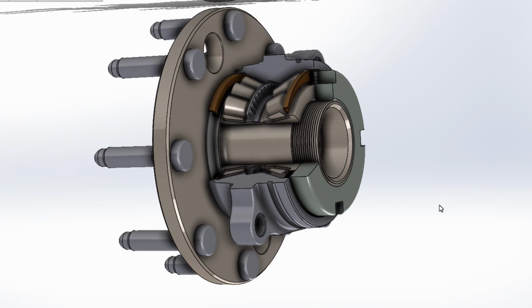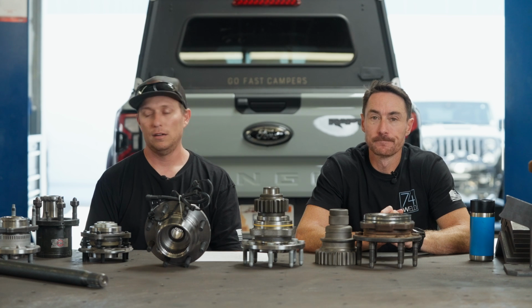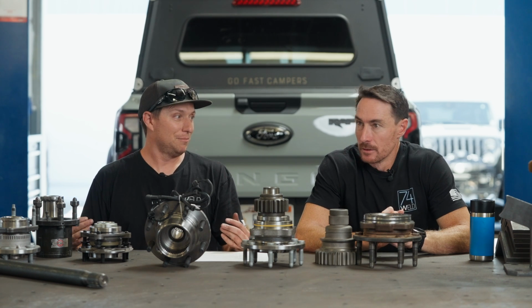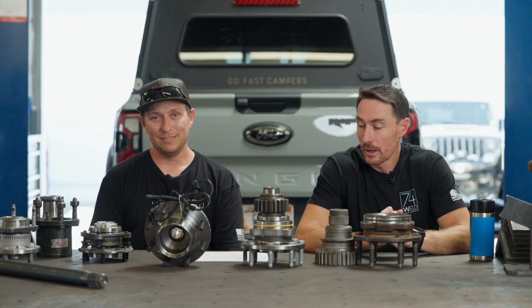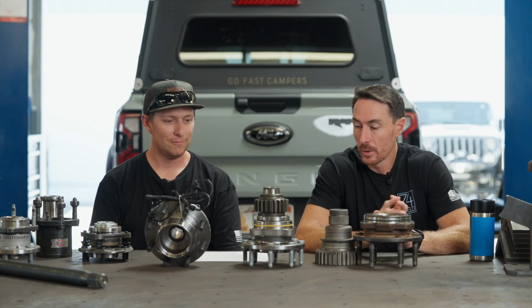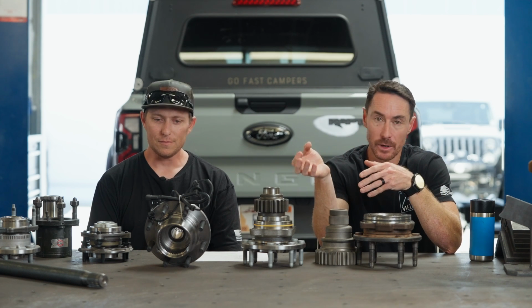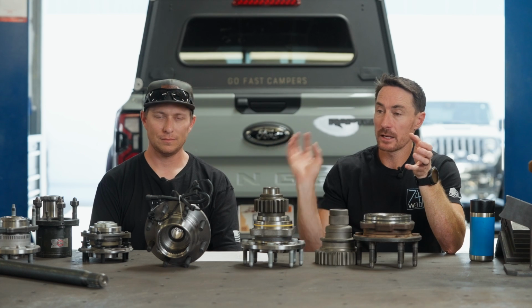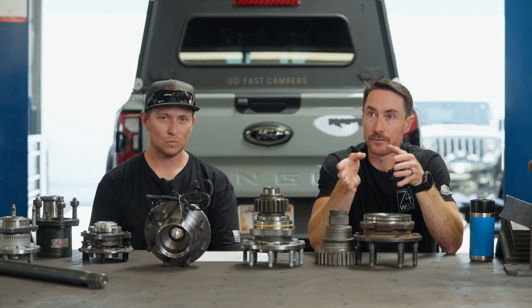So what's good about a unit bearing? Well, it's a single replaceable unit. It's going to be cost effective because OEs make them by the thousands, tens of thousands, hundreds of thousands. The reason OEs went away from a grease pack spindle to a unit bearing design is so that with 4 bolts, you can take it off, throw it away, and replace it with a new one. It's strictly for efficiency.